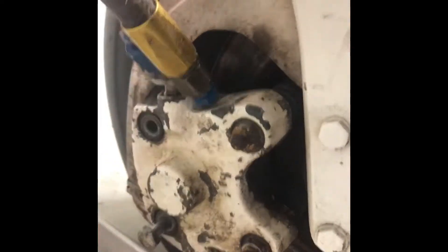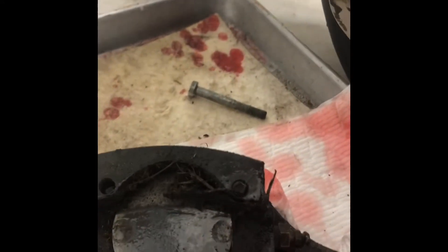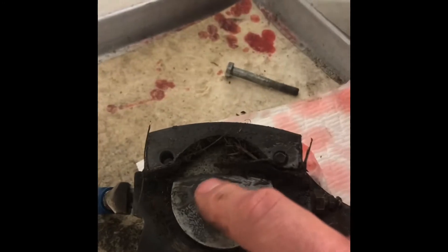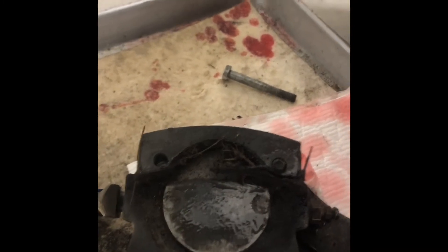Here's the back — note the fluid all over the brake pad. Take this and slide it out once it's disconnected and capped. If you look at the backside, you can tell it's leaking because this is all wet. We'll clean it up, do an inspection around there, make sure there's no cracks on the caliper. While we're at it, look at the brake pads — they look good but we'll clean them with brake clean. We're gonna pull this puck out and replace the o-ring.